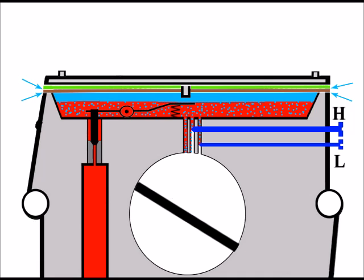So you can see there we've got fuel and we've got air above it. So we're getting less of a fuel line there. The tide line of fuel's going down and down all the time. And we'll also undoubtedly have air mixed in with what fuel we've got up there. Now, because we're drawing in air in these places that we shouldn't be, we've actually lost the vacuum in the metering area. And it's the vacuum that we need in order for the metering diaphragm to be drawn down.